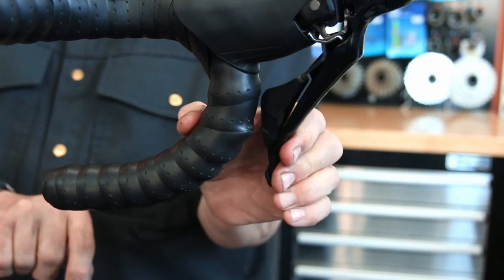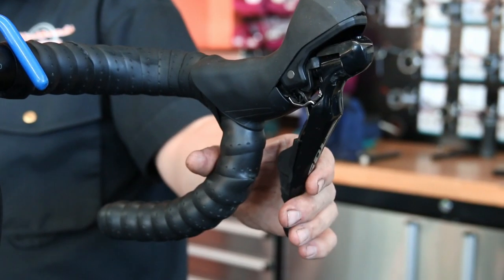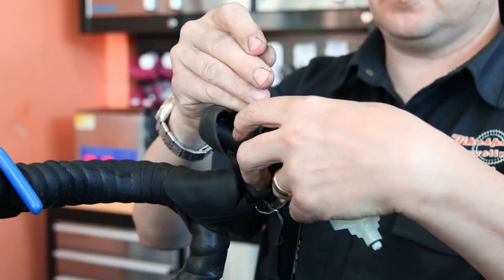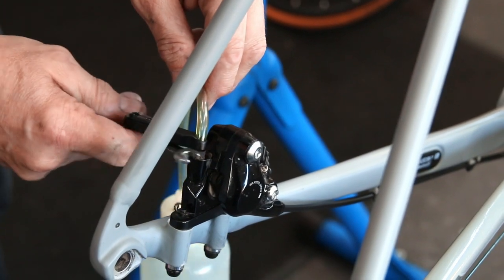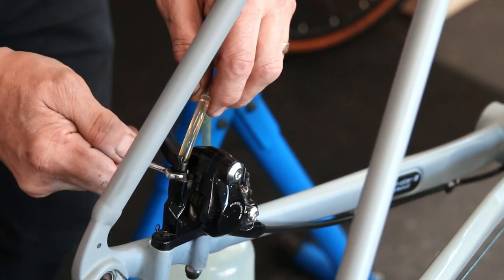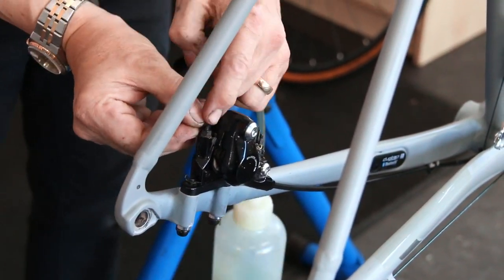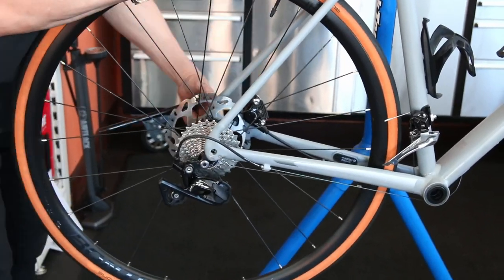This is something that happens a lot on bikes — you can see there's absolutely no movement between that brake and the lever from new. There's a little way you can trick the bike into believing the pads are slightly more worn: first, just pump that brake a few times without popping the pistons out, then bleed off the brake port to make sure it's absolutely full of fluid. When you put the wheel back in, the bike believes that gap is the correct amount, giving you slightly better actuation so you can't pull it right to your handlebars and trap your fingers or lose braking.